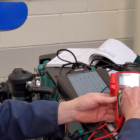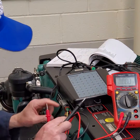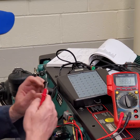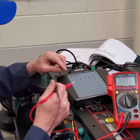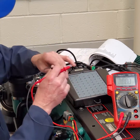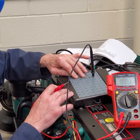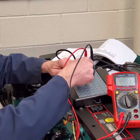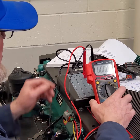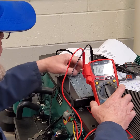I'm going to turn my multimeter to frequency. I'll take my harness plug and look for my ground, which is pin 4, so I'll put my ground lead on pin 4. Starting at pin 10: pin 4 is ground, and pin 11 is my first communication link — that's pin 2. I want to see if I have any communication signal there. The other one is pin 5, which maps to pin 14 on the breakout box.